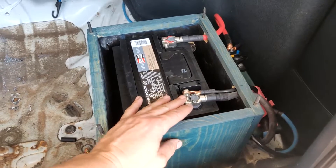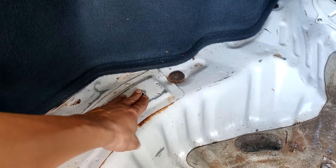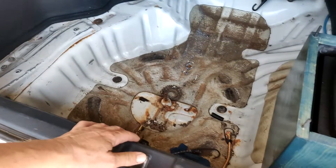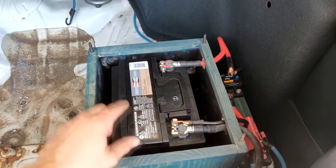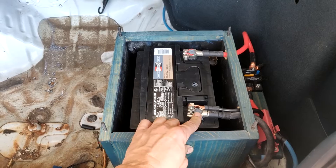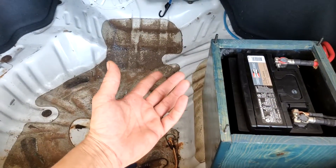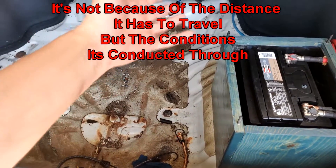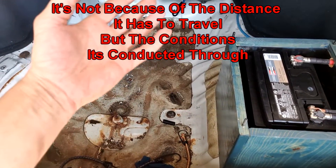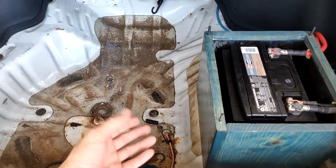This is where most people run into problems with battery relocation. They take the negative terminal and run a short cable to the rear chassis, shave off some paint, make a solid connection — seems like that should work. The problem is we're running 12 volts all the way up to the front of the car, and it wants to return to its source at the negative terminal. To return to its source it has to travel through all that metal, which essentially turns the car into a giant resistor. A resistor drops voltage as current travels through it, so we go from 12 volts down to 11 or 10, and as you turn on more things they begin to shut off.